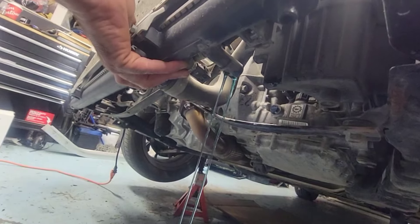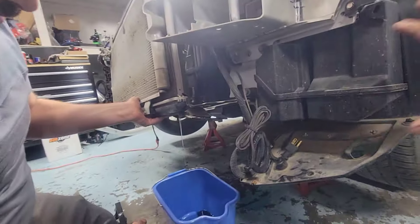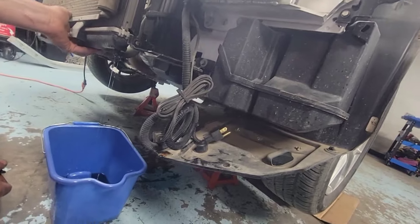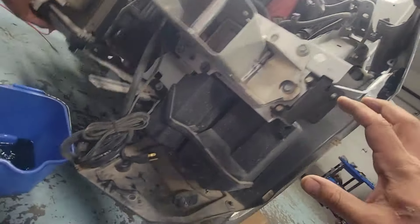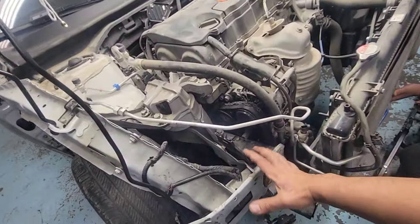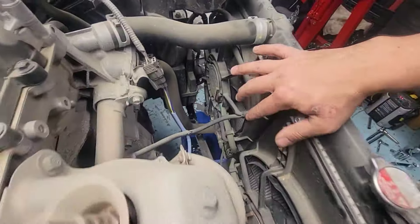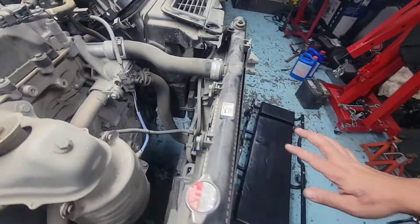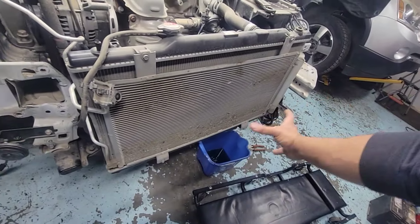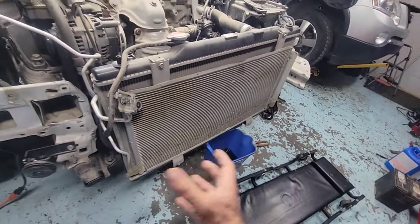Just a quick drain on this coolant. It's probably harder for you guys with the bumper on — you'd have to take out the shield underneath. We took the bumper out because we're pulling the engine on this car; the body shop is going to pull the frame out and replace this whole section. After draining the coolant, we're going to disconnect the upper and lower rad hoses. We'll leave the condenser attached to the line and swing the whole thing over.